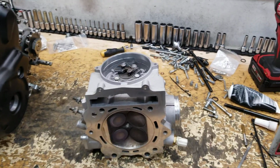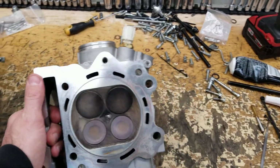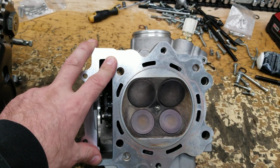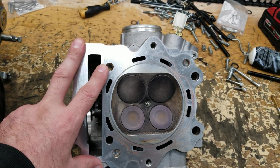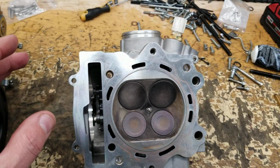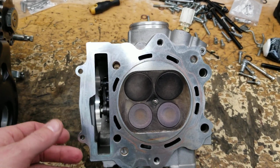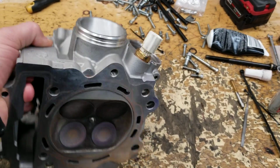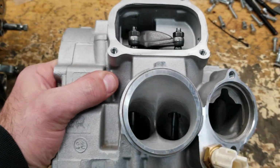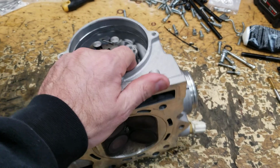We do a little bit of chamber work on these. We don't get too crazy on them. The key to these head packages is pretty simple. This one's been ran before on a 734. It's like an 80 horse 734 package, high compression. And then on 110 or E85, and then we can bump up from there. But pretty standard stuff. As you see, we don't punch through the roof or get real aggressive with this porting. It's very simple. Works really well.